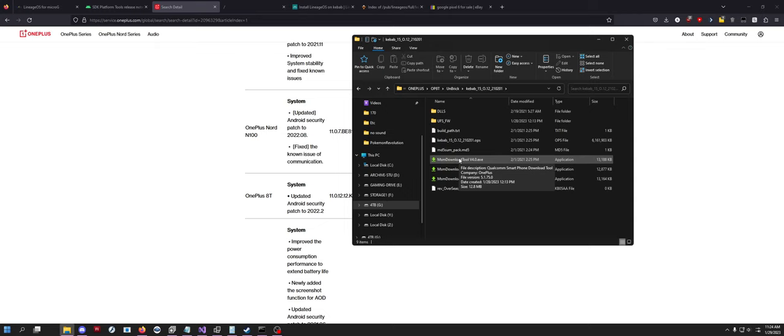They're flashing it at the factory settings. This is not Android recovery, factory reset. This is full reset, reinstalls all the partitions, makes it a perfectly clean phone. If you are starting from nothing or you're willing to reset, this is the method I recommend: use the Unbrick tool even if your device is not bricked.